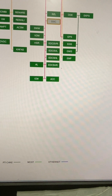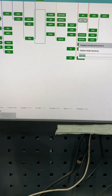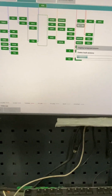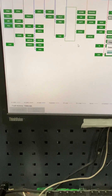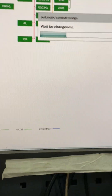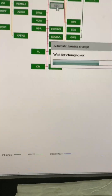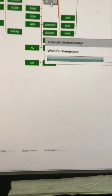So now if we start the vehicle test again, it should go green in theory. You want to be a fault finder — this is what it's all about. We'll delete the fault memory now and see what comes back. If that fuse is blown again, it means we still have a problem. Look — so now we're okay. We just erased the fault codes and now we've got comms with DSC. So now we need to work out from that bloody list which handle is faulting.